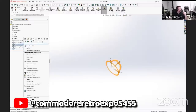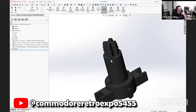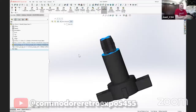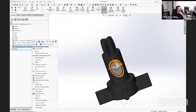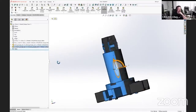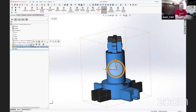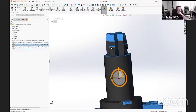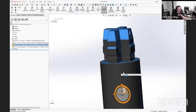On a standard 64 keyboard, it has what we call the 5mm plunger — from the base to the top is 5mm. For Commodore, for whatever reason — and I'm guessing it's because they wanted to cut corners — they made a 3.5mm plunger. You can right away see the difference here; that's how much taller the 5mm one is. It also has a different location for the tang that holds the keycap in. Which also means that the short plunger keycaps are not compatible with the long plunger keycaps. Period.